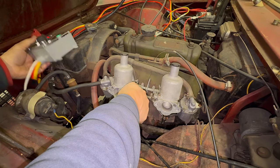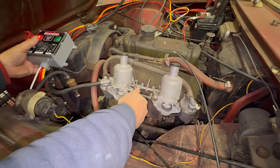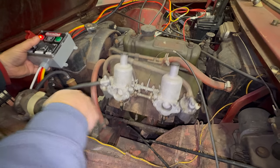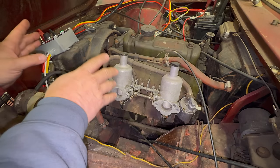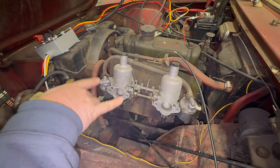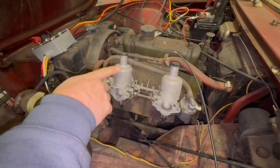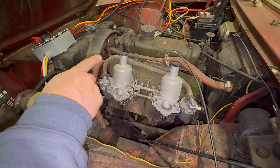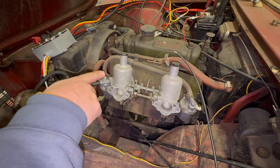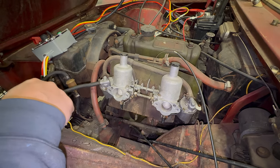Get the chokes out. I don't want to run it too much because the water pump is not hooked up, so I think this is as far as I'm going to go today. I do need some parts: a rebuild kit for these carburetors, a fuel pump, and I should probably get some points, a rotor, and a cap. I need to find the generator so I can put it back on to make the water pump run. So if you want to see me continue working on this car, comment below — otherwise I might just stick this back up on my shelf. If you want to see more videos like this, comment below and click subscribe.